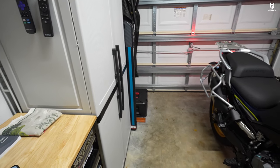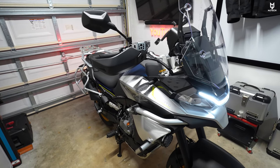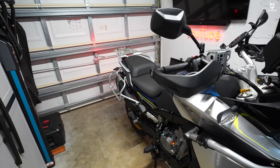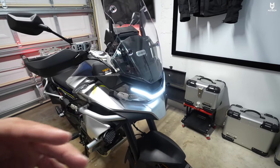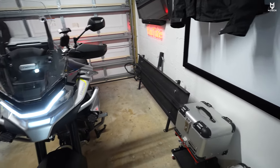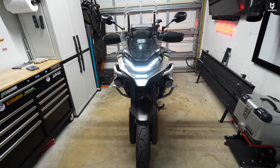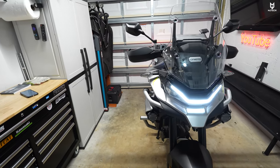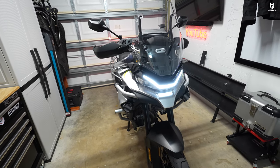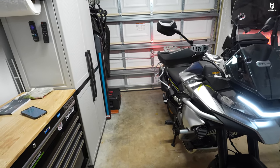When I completed that video, I rode it for about 80-85 miles approximately to the house from the dealer and I didn't have any issues. The bike was just fine, no problems whatsoever. But then after some time, off video of course, I started riding it around the city and I started getting some MCU failures. That's the computer inside of the bike. I was getting a message on the display stating there was an issue, and it was also causing the bike to overheat. Basically there's a software glitch where the bike doesn't start cooling — and I'm talking about the fan specifically — after about 206 degrees Fahrenheit, which is quite hot already.